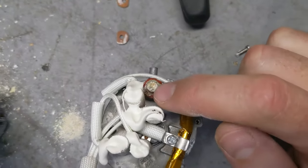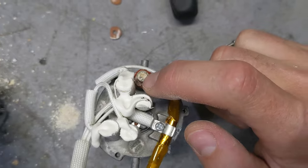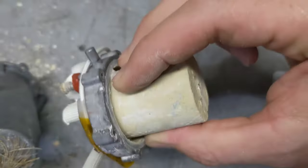So here it is. If you look at it, this is the intake port, and it's completely clogged — water cannot circulate through it anymore. So I have to clean this one out to let the water go into the heating element.